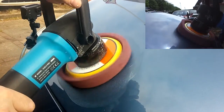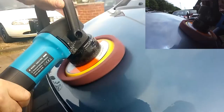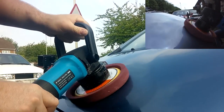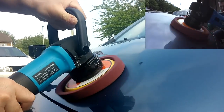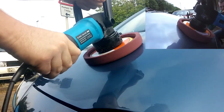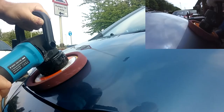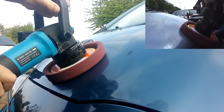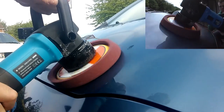In regards to how you use it: don't turn it on until the polisher is actually touching the paintwork of your car, because it will just fling the compound everywhere. As it's moving around, you don't want to be forcing it in either — you just want to be holding it down and letting it work its way around. Guide the direction but let the machine do the work. You don't need to force it down into the paintwork because you'll end up ruining the job you're trying to do.